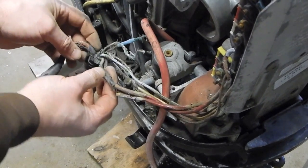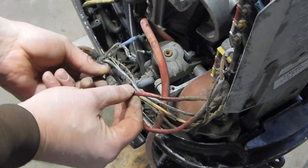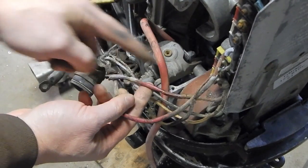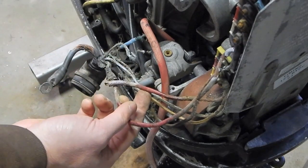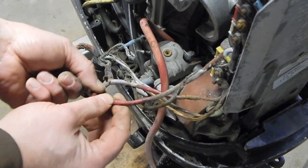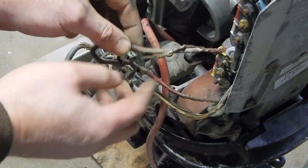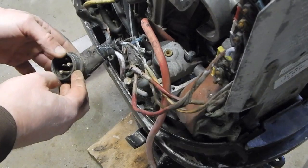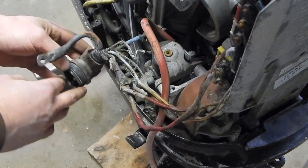But for small wires, we've got these two thick wires that pair up together. One of them goes right to the rectifier, so the 12 volts coming out of the rectifier is going out of this wire through the boat circuit and then probably coming back on this wire and going up to the red connection on the switch block. Pretty straightforward. So which of these pins is which? That might be an interesting thing to know.